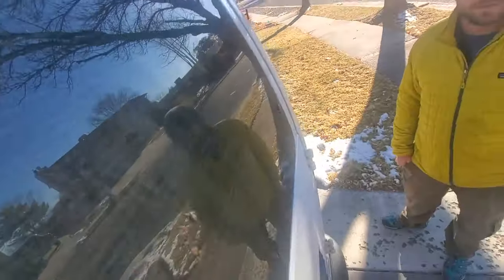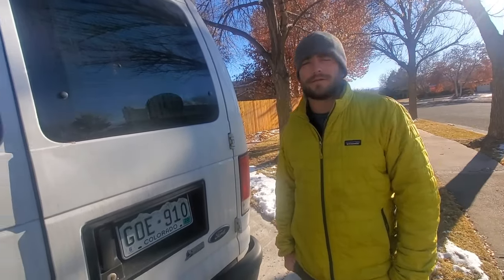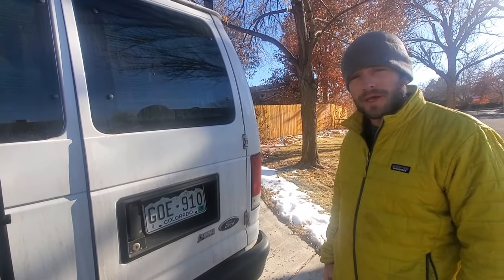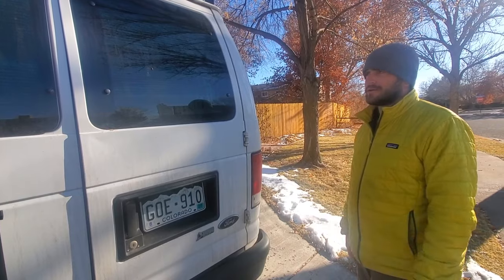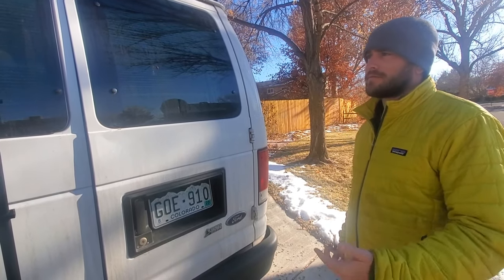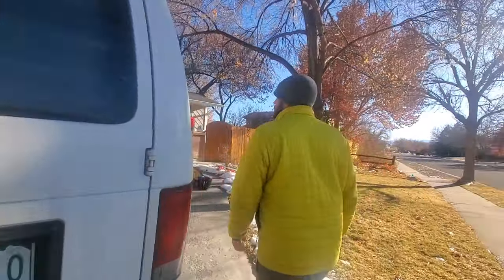I did put in, as you'll see, I had a lead acid battery at first, two 6-volt lead acid batteries, and switched to a 12-volt AGM battery. Doesn't spill, doesn't need refilled. A little more compact and runs everything great. All my lighting's LED, and the inverter runs fine off of it. It's just a little easier to maintain, basically.